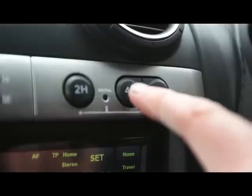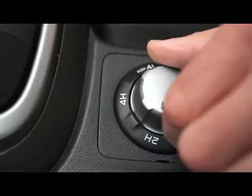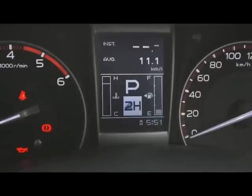Now let's take a look at how the new Isuzu D-Max compares in four-wheel drive. In four-wheel drive high, the Rodeo and the new Isuzu D-Max are much the same — both are selectable electronically and also whilst on the move or stationary. The more modern graphics on the Isuzu D-Max, however, give the driver more information regarding selection and less possibility of accidentally selecting four-wheel drive whilst on the move. The D-Max's more advanced brake traction control system also has improved off-road ability.